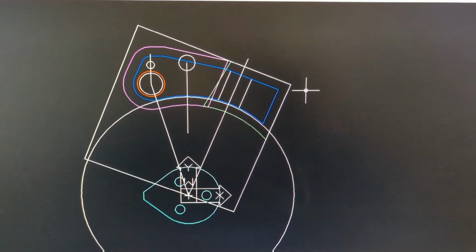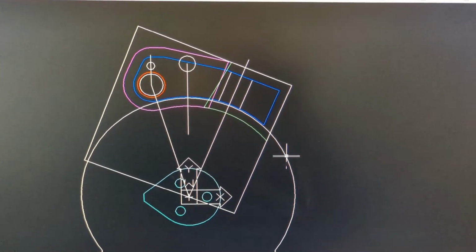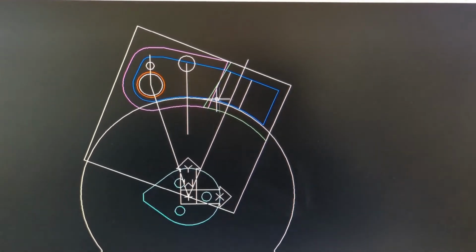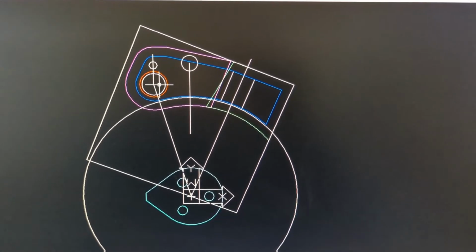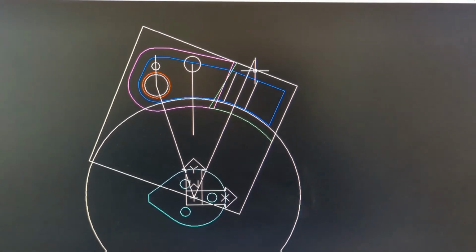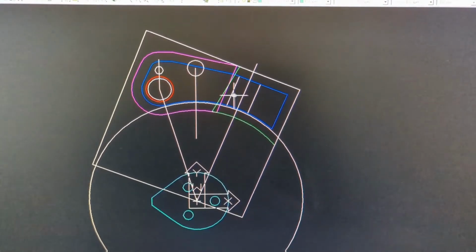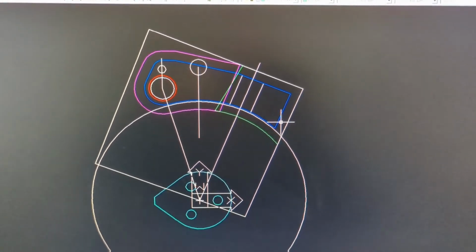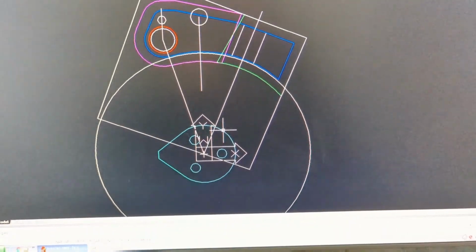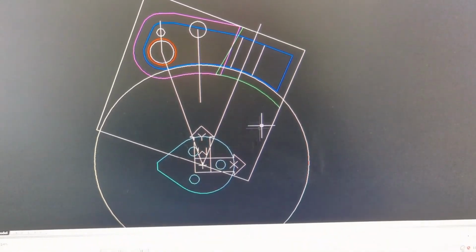So this is my AutoCAD model of the crank and cam trigger block. The trigger wheel is represented by this circle here. The blue line is what the block will be, in a piece of aluminum. So there'll be the cam trigger there and its mount hole, and then this is a through hole here for the crank trigger itself. I have to machine pockets and stuff down in it, so anyway, I'll make a machining strategy and a model off that. There's the little plate I'll make for the cam trigger. Anyway.